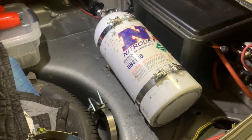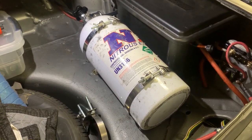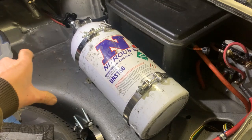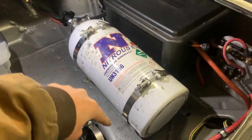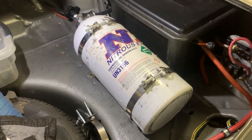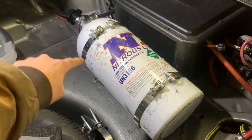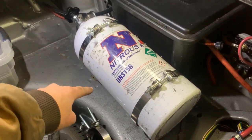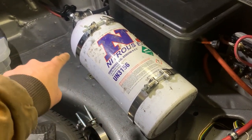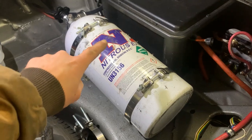I've been trying to figure out how to mount the nitrous tank. Mounting the tank itself isn't too hard, but what's underneath is the difficult part — underneath here is my fuel tank. So I can't just stick holes anywhere because I'll be drilling through the fuel tank. You can see those divots — that's where my rear rail goes up through there. I need to be on either side of those spot welds, in between the two rails, and then I can mount on the other side of the rail.